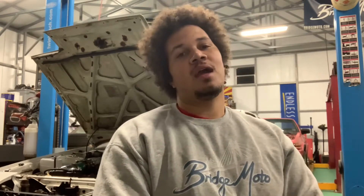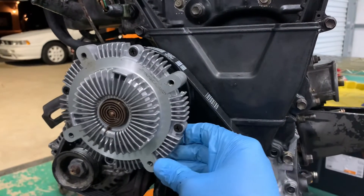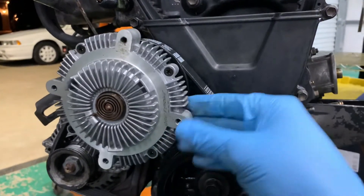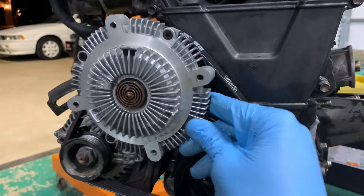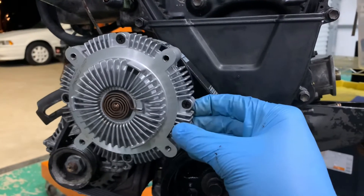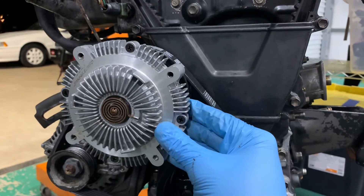When it comes to clutch fans, I think there's a lot of misinformation about the utilization of a proper clutch fan — how they work and their proper benefits when used in good condition. So this is what a clutch fan looks like, obviously without the fan blade on there. This one's in new condition. One issue I see is guys trying to replace these with the same make but not the same model clutch fan. There are actually thermostatic differences between each clutch fan specific to the engine application, so you definitely want to make sure you're getting the right one.